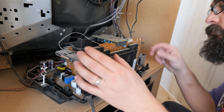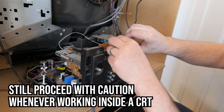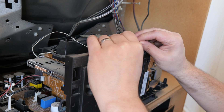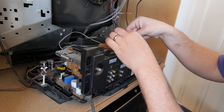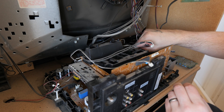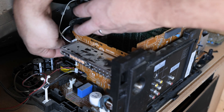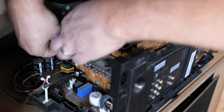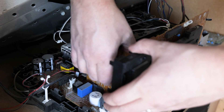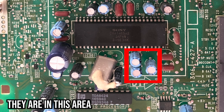The interesting thing about this TV is that there's a cage of boards here. The ones we need aren't on the board on the flyback, so we don't even need to screw around with the anode cap — we just need to get to these separate boards, which can be removed. I removed the board on top first, then went around disconnecting all the cables on the vertical boards. It really helps to take pictures of your disassembly, or even film yourself, because then you can go back and watch the footage if you're ever unsure of how it comes together. After disconnecting the wires from the vertical boards, I removed the back board with the inputs as well as the two boards to the left and right of the M board, which is my first target.